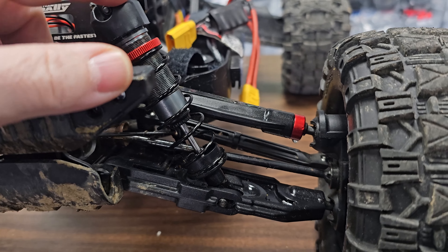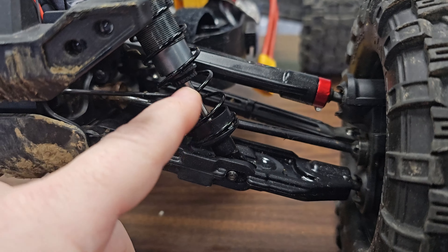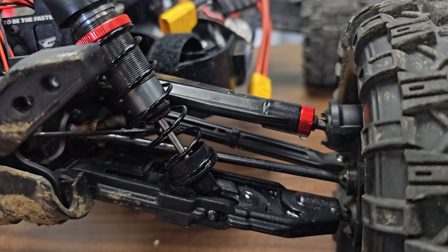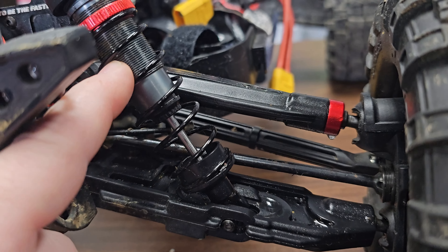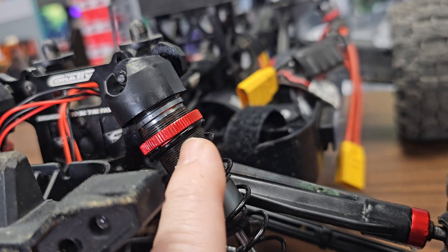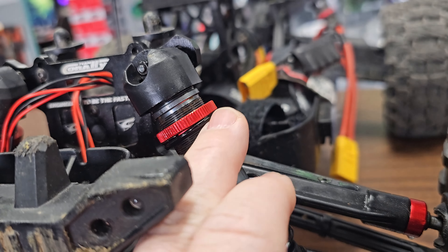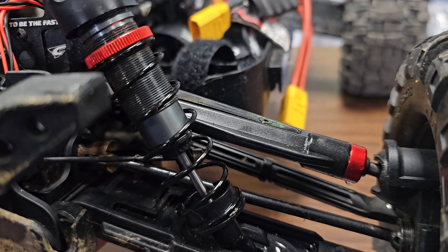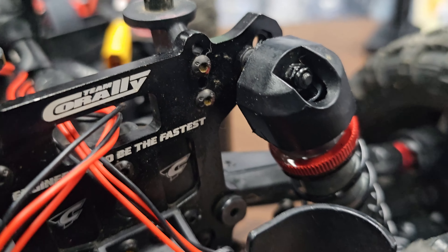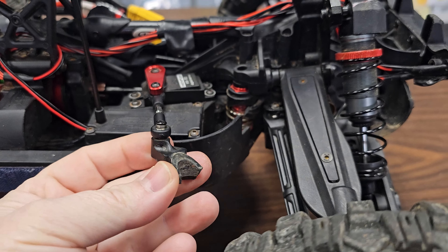He's got a shock that's leaking. Most likely this is from dirt and some other stuff getting down on the piston, maybe going up in there and opening up that O-ring and leaking out. It could also be his cap — I can't tell. Looks like he put some cleaner stuff on here, so I don't know if that's from that or not, but we'll take that apart and investigate it and see if we can avoid having to do a rebuild on it if it's something simple.